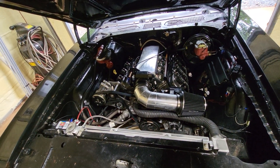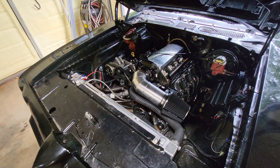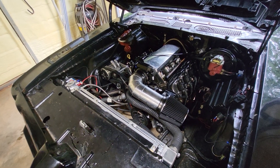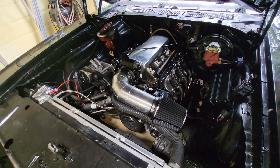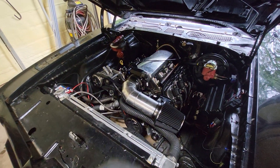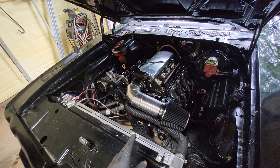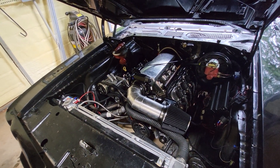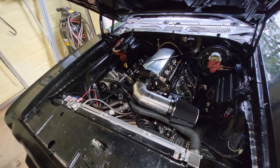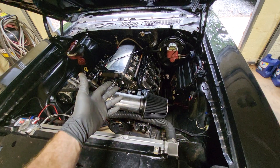Only the best intake — only the fastest cars run this intake. Anyway, it had a stock 21-pound injector in it and they had spacers to space the injector to fit the height on the tab. I'd never seen this done before, but they put the spacers on the bottom side of the injector, so the spacer has just a really tiny hole at the bottom — it was really screwing up the spray pattern.